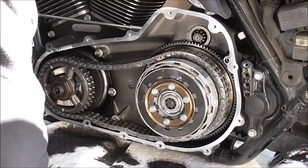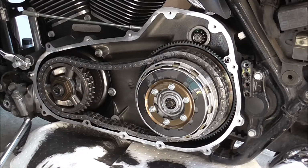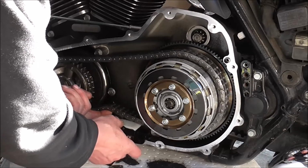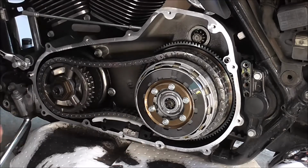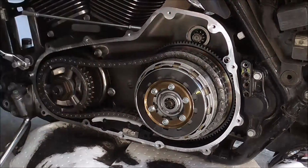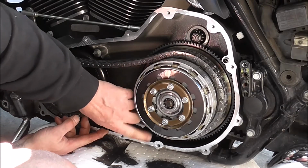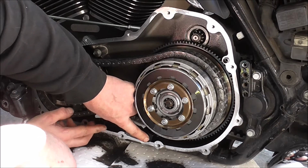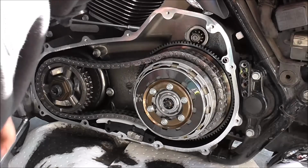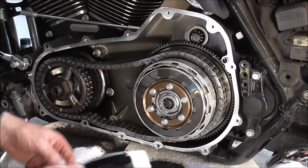One thing I want to check. Put the manual adjuster in. Let's see how it sits in, and lines up. I'll take this back out in a second and give you a better look at it. I'll just get it to where its holes are. That's spot on. I've had these in the past where they don't sit straight, and you've got to put a spacer behind them. So I just thought I'd give that a quick check before.